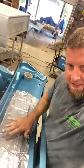So once it's blasted and epoxied, I'm gonna cover up the louvers on the top side to keep anything from getting on the tape and loosening up the adhesive, because I don't need a lot of activity going on top of the louvers. Then when it gets almost to finish time, I will pull the tape on the front side and hand sand inside the louvers, and then I will leave this tape here. And then when the car gets painted, it's all done.